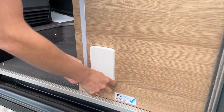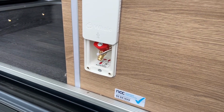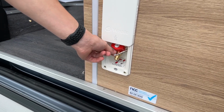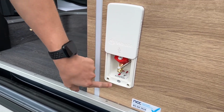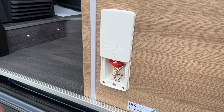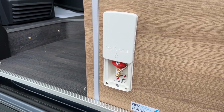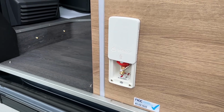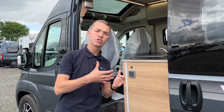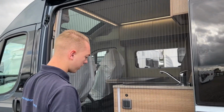If you plan on doing a bit of outdoor cooking, you've got an external gas point there, so for a Cadac or external barbecue. There's a little fitting here which you need to just cut off with the cable tie there. That'll fit into the bottom of here. Then you'll need some gas hosing and some Jubilee clips to connect it all together from the connection point to the Cadac or external barbecue, and then that'll allow you to turn the tap on. That will use the gas tank on board instead of you carrying a separate bottle to use your Cadac. Fly screen on there.